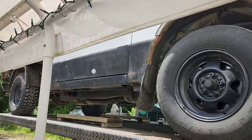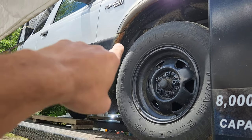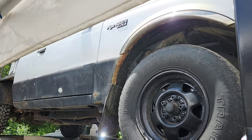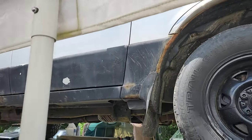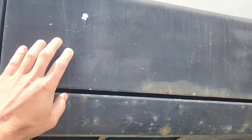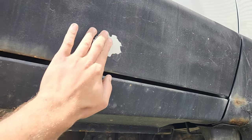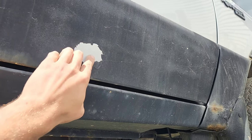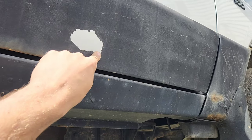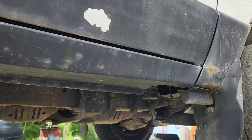As you can see, the rust eats into the wheel wells here — that needs to be re-sprayed. This is just regular good old-fashioned AutoZone bed liner spray. I didn't scuff the paint enough, so it has chunks where it didn't quite hold — you can see it coming off. So I need to re-scuff it and redo it.